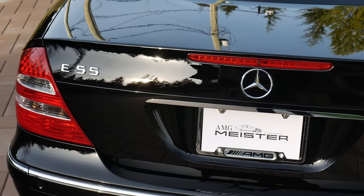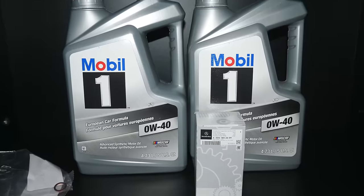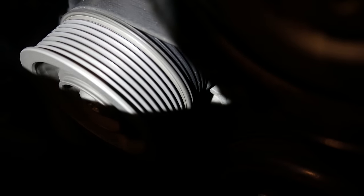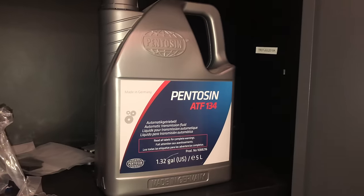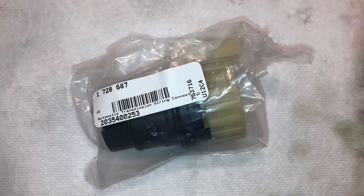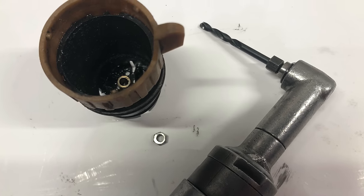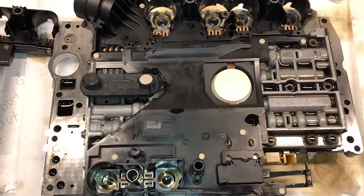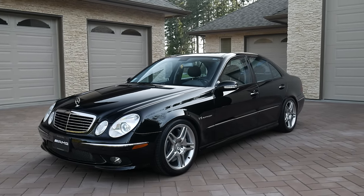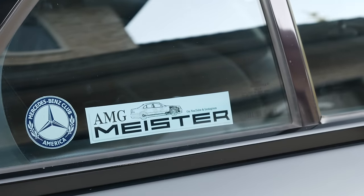With the paint super clear even in direct sunlight, I took the car for a drive and then proceeded to do a bunch of maintenance. I changed the engine oil and air filters, and replaced a bearing on the double idler pulley that was making noise. Then when I went to service the transmission I found the electrical connector was wet. I went to replace the pilot bushing — a common issue — but the brass fitting holding it was stripped because a Mercedes dealer had over-torqued the bolt years before, so the conductor plate had to be replaced. Otherwise everything went back together fine, the car drives really well, and we'll go for a drive in the next video.